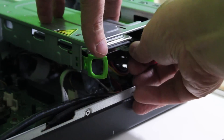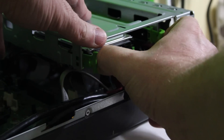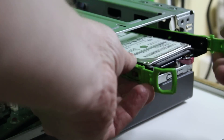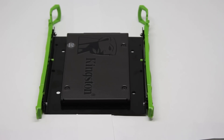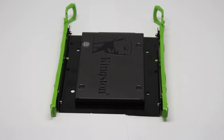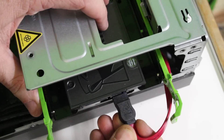It'll have two cables in the back: one for power and one for data. You unplug the cables and take out the hard drive — that may have a mounting mechanism with screws, or even just a tray that pops out as in my case. Then you physically replace one drive with the other, reconnect the cables, and pop it back in.